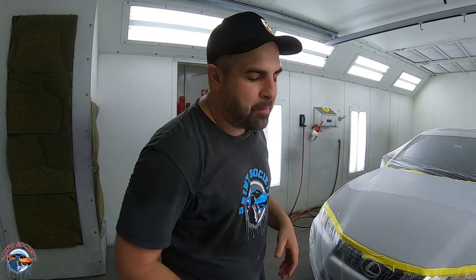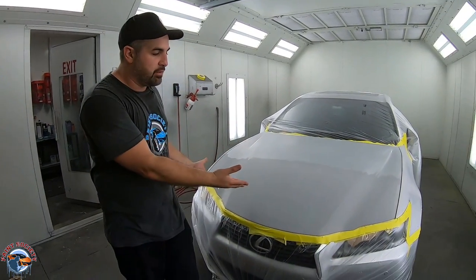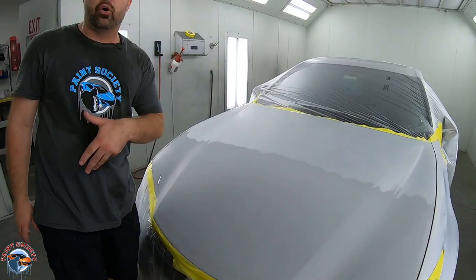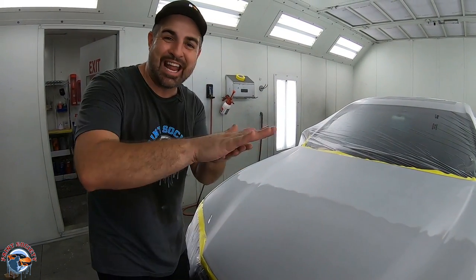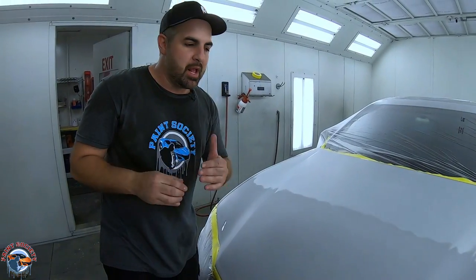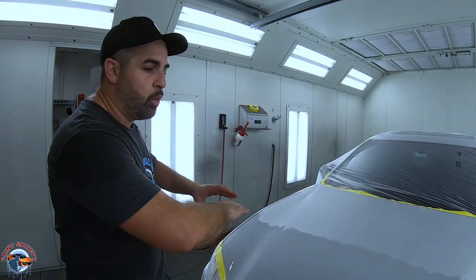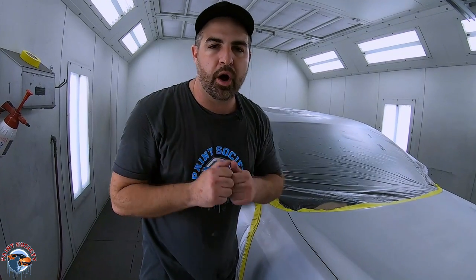It's all masked up and looking good. In an ideal world we pull off the bumper and the lights, but this is a job — and that's all we'll say about that. So let's talk about what we have. Many people ask me: 'Brian, what's the difference between a primer and a sealer?' Take a look at the hood — this is primer. Primer covers all the bondo and bare metal, goes down, sands smooth, and is a bit thicker. Sealer only comes after primer, and it goes over the whole hood to give us a nice even playing field — a brand new surface for our silver metallic.